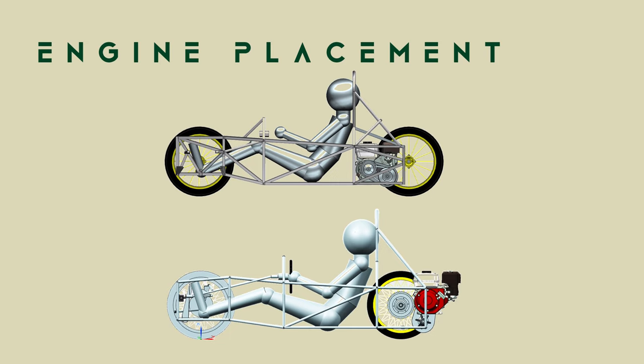Beam axles can be made to work but there are several compromises with respect to dynamic wheel geometry and steering effort. Adjustability is a main goal and the knuckle designs on these cars are essentially set-and-forget. For low steering effort, this design inherently has a large scrub radius which is a leading cause of large steering efforts. A fun fact: in pre-war cars which had these setups, they added positive camber to move the contact patch closer to the kingpin intersection, which reduced the scrub radius and made them easier to steer.